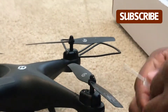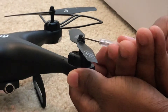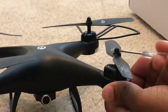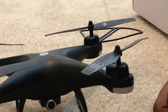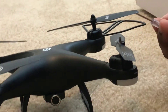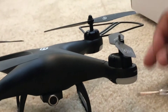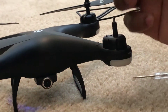Okay, I'm going to go ahead and take this loose. It's about the smallest screwdriver I have ever seen, and the screw is not that tight, so you don't have to worry about forcing it out. Give it a nice turn and it comes loose. You want to sit the screw somewhere safe — I'll use one of the light covers to hold it. Now we should be able to remove the cap. Using the screwdriver to remove the cap — there's a cap and a ring, and they came off together. Now you should just be able to lift the blade right off.